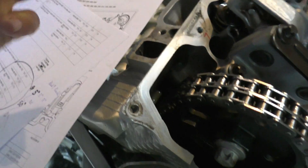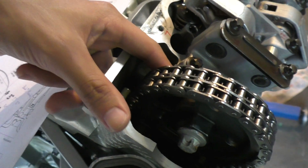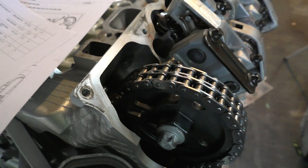There's actually a tool you can get for checking your timing — the tool goes right over the key on the camshaft, and if that tool fits in it means that your timing is at the right point. I'll take you along and show you how I do this test.